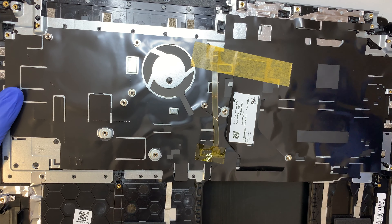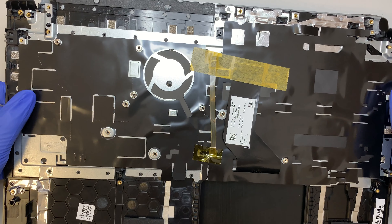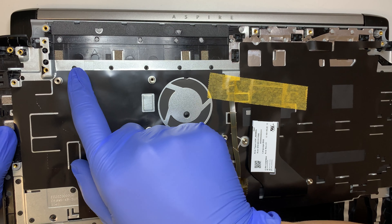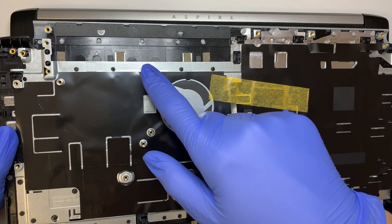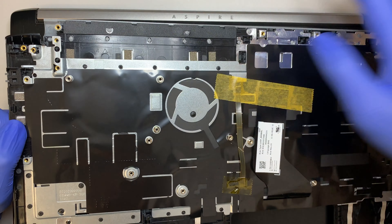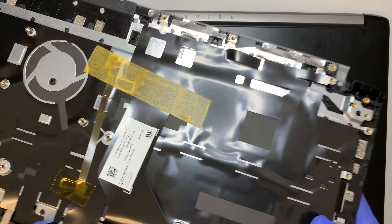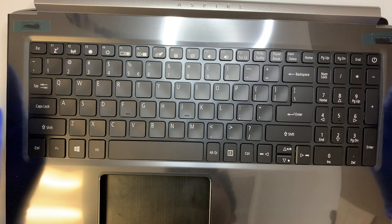The reason why I'm not able to change out just the keyboard itself, but rather change the entire palm rest, is because the keyboard is not a separate component. The way they make it, the keyboard is punched down by the manufacturer — it's not a screw that holds the keyboard, it's a punch-down plastic that holds the entire keyboard. So when you replace a broken keyboard, you would have to replace it as an entire piece just like this.